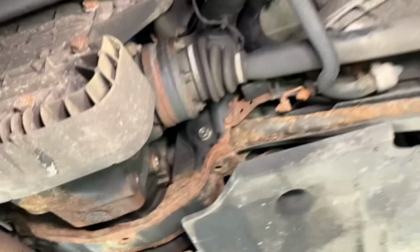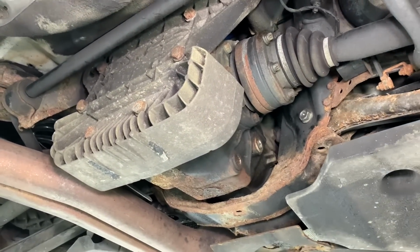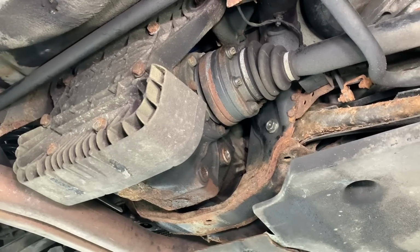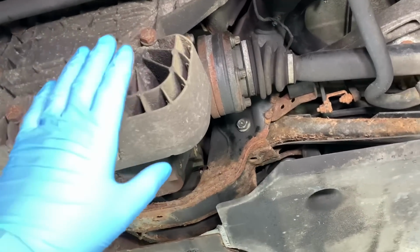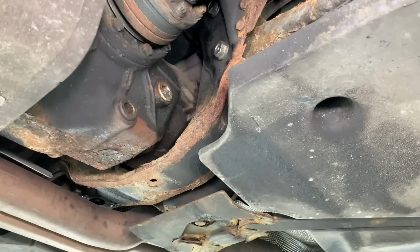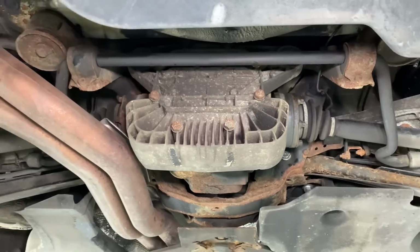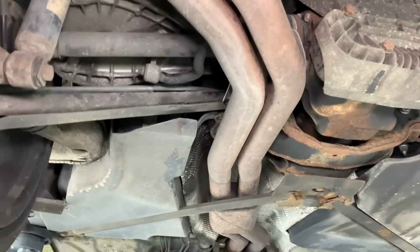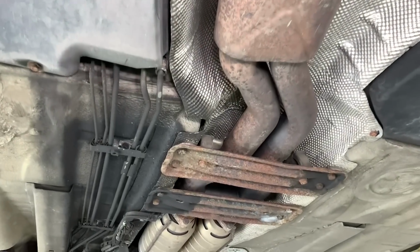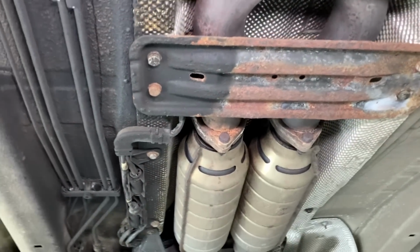On our initial road test, we experienced the typical grinding noise when doing slow speed manoeuvring, parking, turns and slightly slower turns. That's the differential clutch packs inside grinding or slipping together, making a grinding noise. So the differential is probably going to require an overhaul if the owner wants to go into it to solve that. We've also got an interesting rotational or mechanical buzzing noise going on from the centre console area, at about 1500 to 2000 RPM, so we'll have to investigate that.